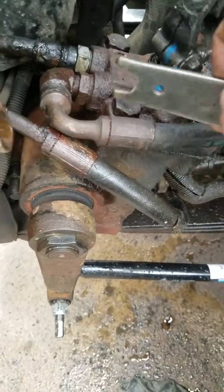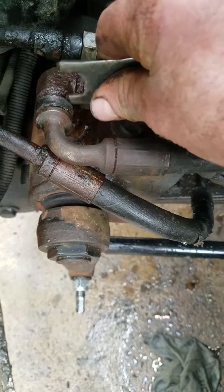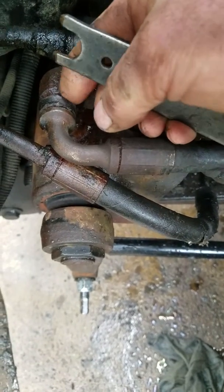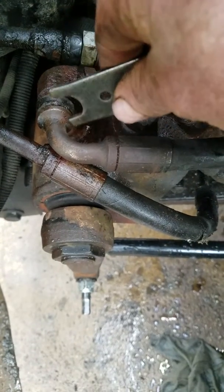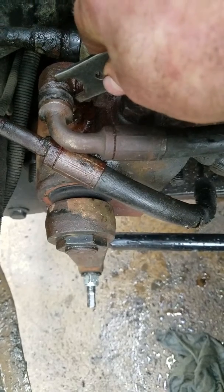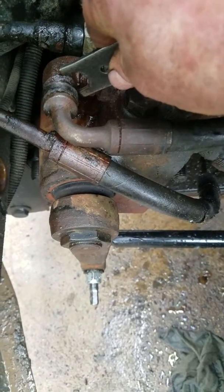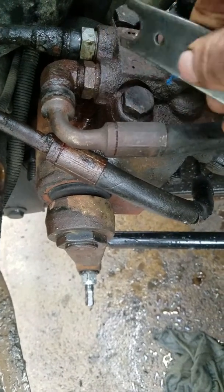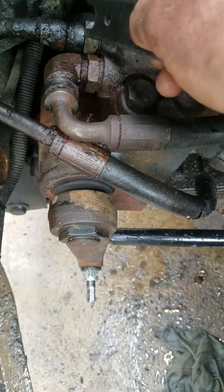Get in here, but you peel this rubber back — these are quick-connect, kind of like a fuel line. Peel that rubber back so it opens up, and there's a little metal sleeve in there. Then you push this in there real hard, push towards there, and it unlocks a snap ring, and then this will slide right off. You don't have to unscrew these from the pump — the quick connect will just slide right out.